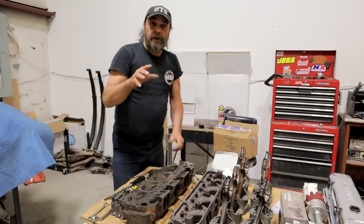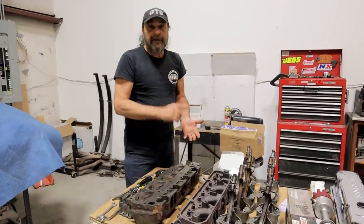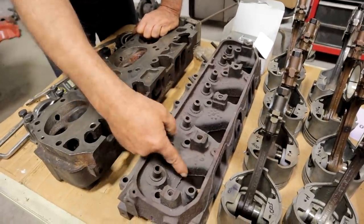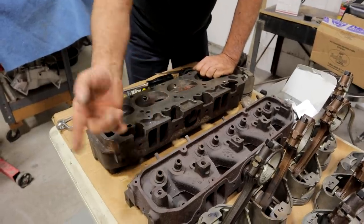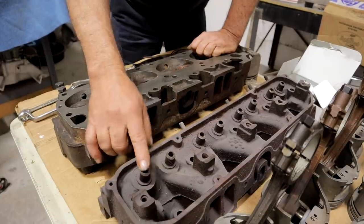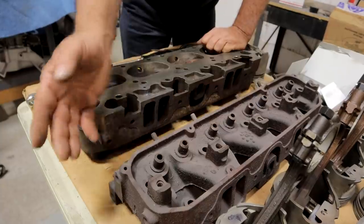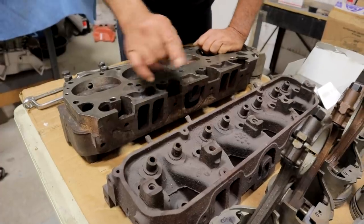Then of course there are camshafts. If you're going to put a higher lift cam than stock in an engine, you have to worry about valve-to-piston clearance, which is something you measure during the blueprinting process. But you also have to look at the valve guides — do they need to be trimmed down to allow the extra lift to push the valve all the way in without the retainer hitting the top of the guide? I generally automatically take these down a little bit for clearance, because even if the cam I'm putting in is good to 550 lift and I'm only running a 528, if I later want to go to 570 or 580 lift I would have to tear the whole thing apart. So I take them down ahead of time.